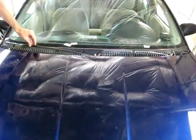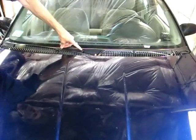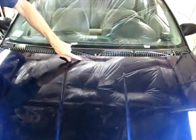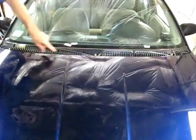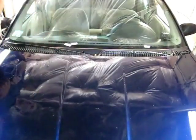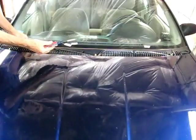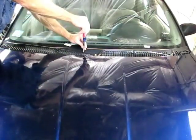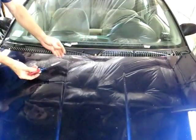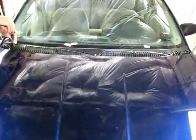This plastic piece right here is held on by four T15 headed screws — one is underneath the hood — and there are four push pins underneath the hood as well. I've got a magnetic tip screwdriver here; they're down in the wells and this screwdriver will hold on to the screw and pull it right out for you.